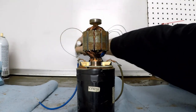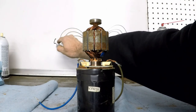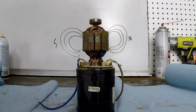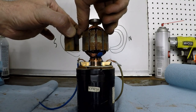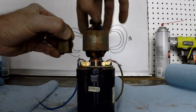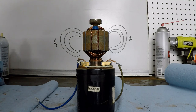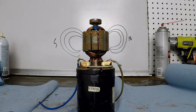The electromagnet you're creating causes a movement — it wants to move away. We use that desire for this electromagnet to push the permanent magnet out of the way to generate movement and torque. That torque is what we utilize to actually open and close your door locks, operate your windows, and in our very specific circumstance here — turn over your engine. Obviously we're talking about starter motors, not just DC electric motors, but DC electric motors are where all the magic happens in the basic format.